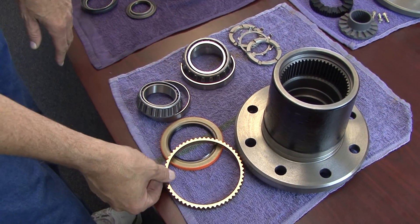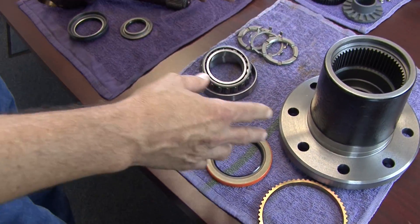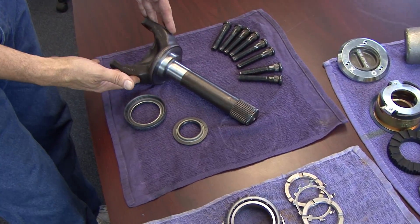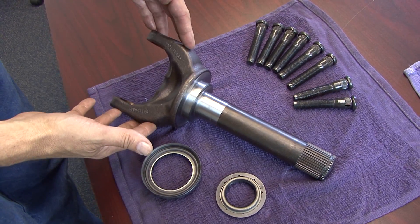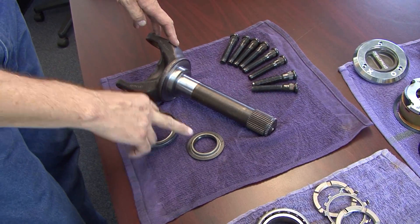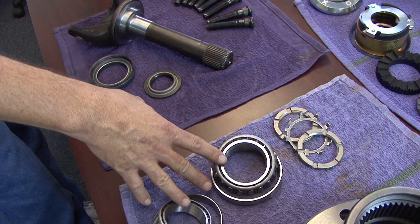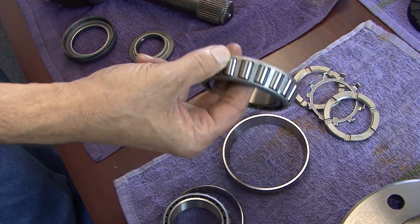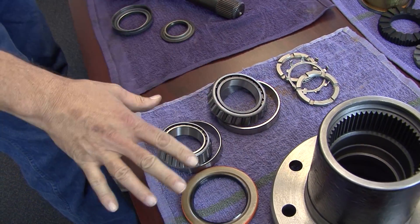Some other components: Timken wheel bearings — the very best in the business, also made in the United States. This is a tone ring made by Dynatrack here in the USA. Seals and other hardware are also all made here. The axle shaft is made from our own forgings right here in the United States — solid chrome moly steel, double heat treated, and precision machined. These seals keep moisture and contamination from attacking the wheel bearings, and unlike the stock bearings, these have metal cages.